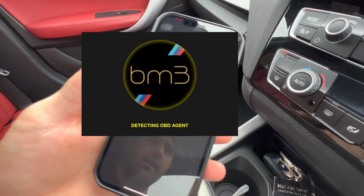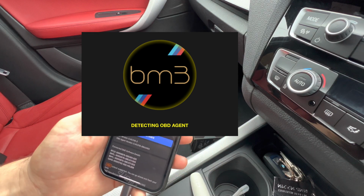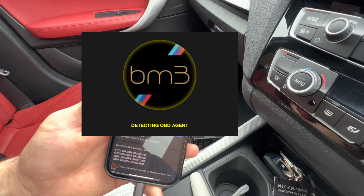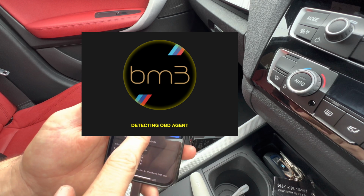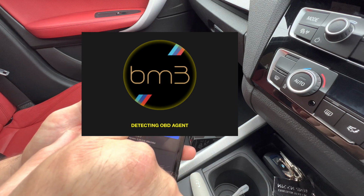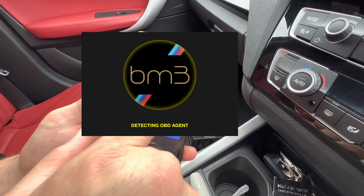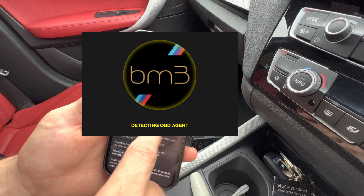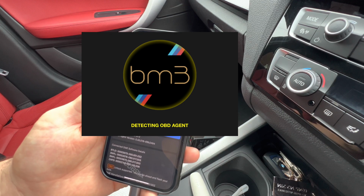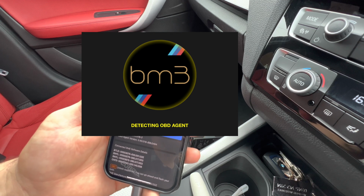But what we're going to do is I'm going to sign in. It's found the VIN number here, and then OBD connected. It says here, no registered vehicles found. To use BootMod3, you need to register your vehicle, connect the Ethernet cable to the car's OBD port, start the BootMod3 OBD agent, and click on activate vehicle below to proceed. So the ignition's on, accessory or whatever you want to call it.